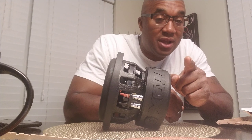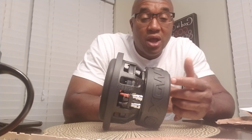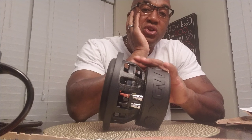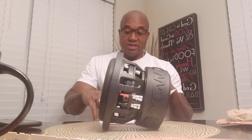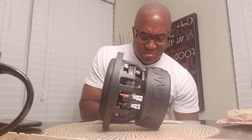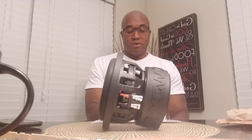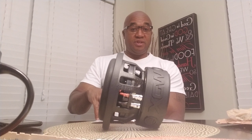For a six and a half inch driver, always tune very very low. They recommend 38 Hz — that doesn't mean you can't go below 38. When I build a box for a six and a half for any vehicle, I tune around 30 Hz. It'll play the higher frequencies fine — the Fs is 58 so 58 to 65-70 Hz is no problem. It needs help to dig low. The recommended sealed box is 0.33 cubic feet and the vented box is 0.64 cubic feet.